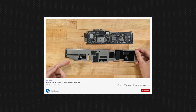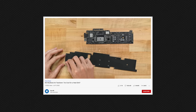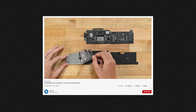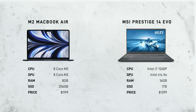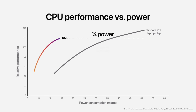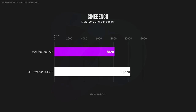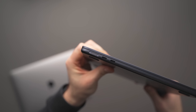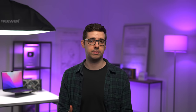There is no real heatsink here at all — usually I'd say that's a poor design choice, but it still manages to squeeze out some pretty impressive performance. Comparing the M2 MacBook Air to the MSI Prestige 14 with a 12-core Intel 1260p CPU — which is what Apple used for that infamous chart — you can see some of the advantages. Although the M2 is not as powerful in raw performance, its chassis is 40% thinner at just 1.13cm versus 1.6cm for the Prestige, it doesn't need a fan, and only needs a quarter of the power.